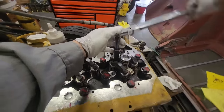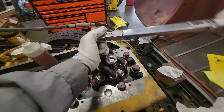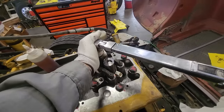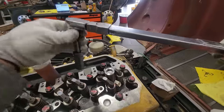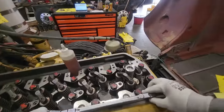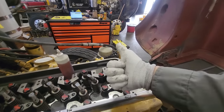One thing — it seems like younger people or apprentices make this mistake. If I ask them what size bolt something is, they'll say 'it's a 13-millimeter,' meaning the head size. It's not a 13-millimeter, folks. The bolt head is not the bolt size. The bolt shaft is the bolt size. So if someone asks you for the size of the bolt, they're asking for the shaft size, not the head.